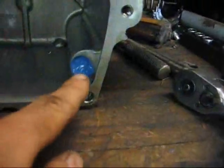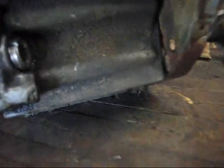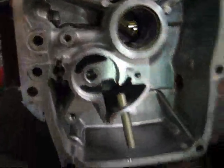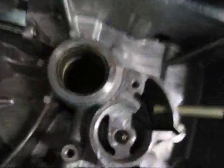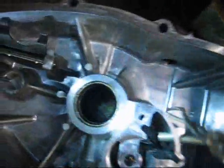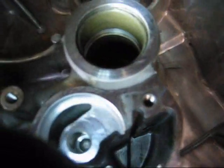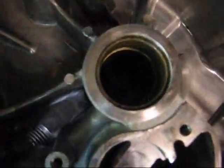I already plugged up one of the oil fill holes, and I'm going to make a dipper on the crank to get extra oil up in there. But these have an oil pump, so normally they suck oil from down in this hole. There's a little hole down in there and it pulls it from the bottom, where the bottom seal is.